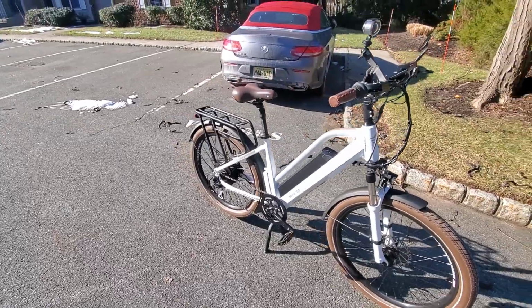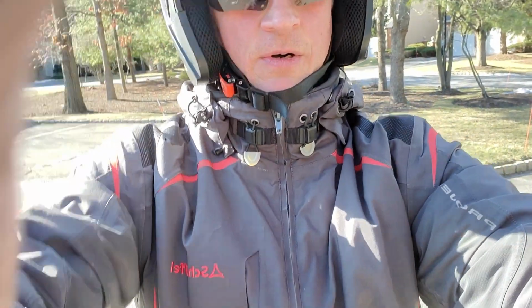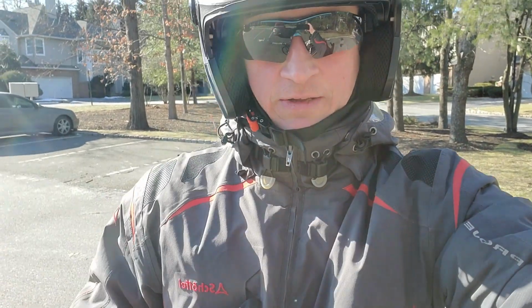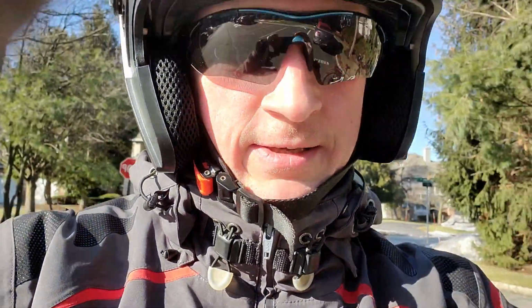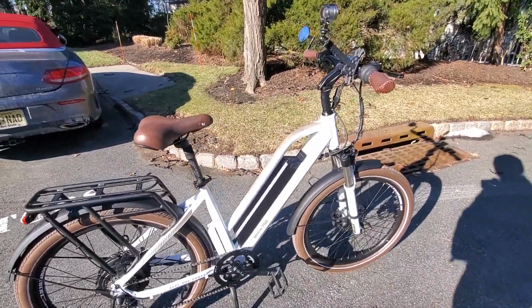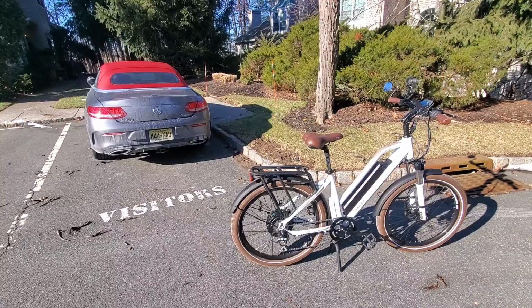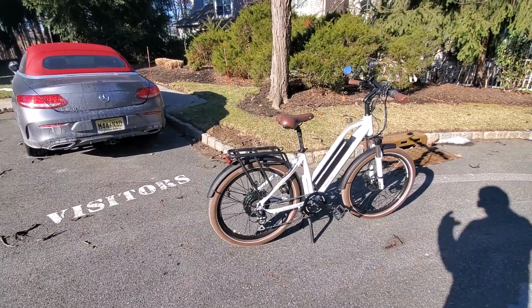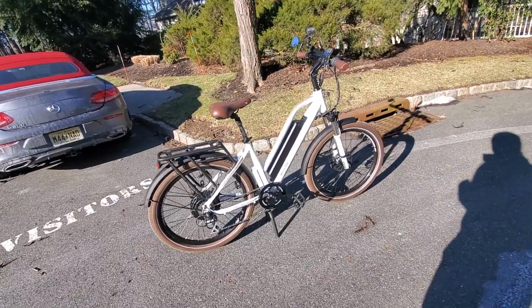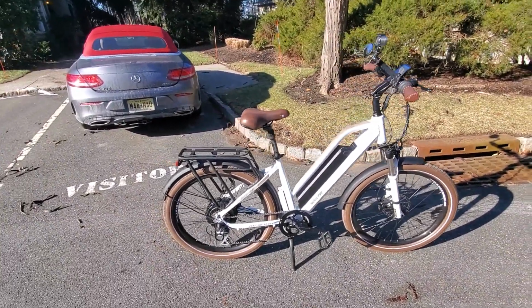Okay, overall, what can I say? I definitely like this bike because look at me, I'm all in a thick jacket that gives a huge air resistance, helmet, jeans, boots. So nevertheless, the bike was able to provide 28 miles an hour on a pedal assist. The only thing that I would change on this bike is this crankset, because at a speed of 28 miles an hour, to give any sufficient human power to this bike, you'd have to spin pedals way too fast. So I will change this chainring to a bigger one to be able to give 28 plus miles an hour.